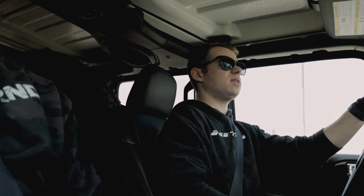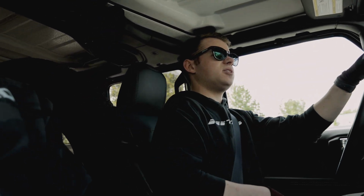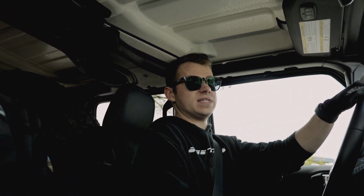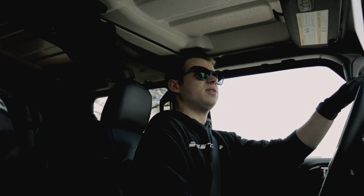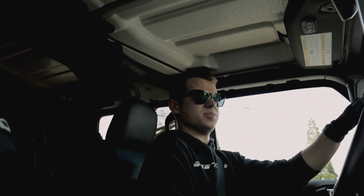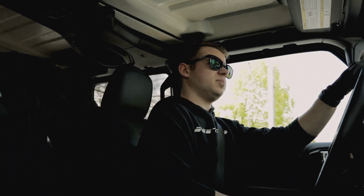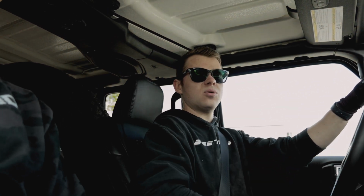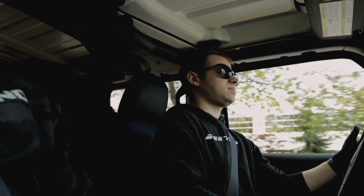Okay. Because when the 2-liter is on and running, it's a powerhouse, and you're running those higher RPMs. It's dumping a lot more fuel than maybe the 3.6 liter V6 would in the exact same scenario. But very similar, with very little compromise, which is what makes this platform so great for most people. If you're unable to charge it overnight, it's maybe not the most viable option, but in most cases people can do that, whether using the level 1 charger that's included or a level 2 charging station on any of the charging networks. Very cool.